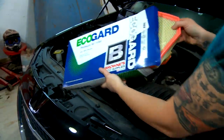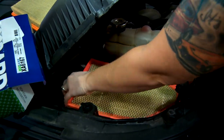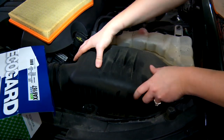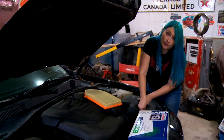Remove your new filter and slide it underneath the air filter box. Push down to make sure that it's firmly in place and replace your air filter box. Locate your screws again and install them back in the tabs, making sure that they line up with the bottom holes.